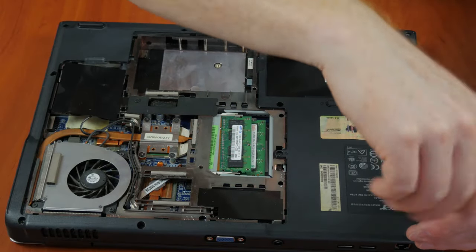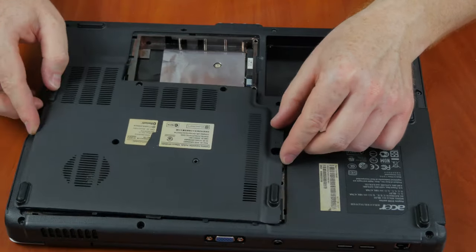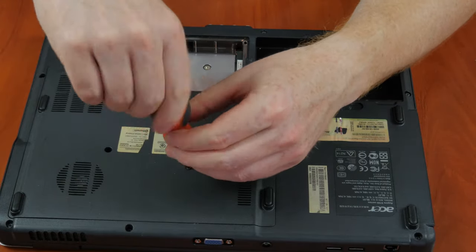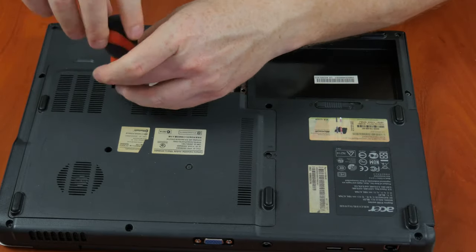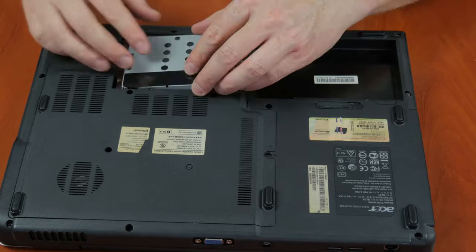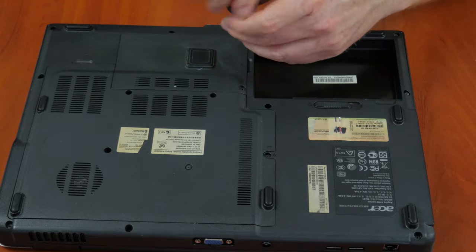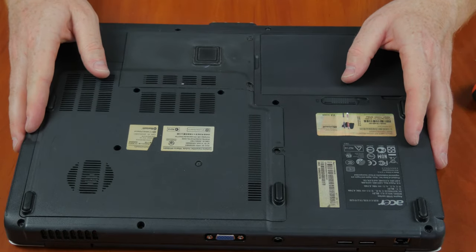For laptops having ventilation openings in the underside, the feet are a must-have. They help to create a clearance between the laptop body and the surface it is standing on, and it makes room for the air intake for the cooling system. After all those steps, put the battery into its proper slot, plug in the power supply and check how the laptop works. Most likely, you will notice that the laptop has become not as noisy and hot as before.